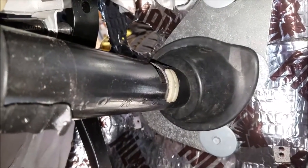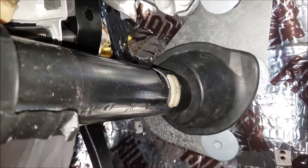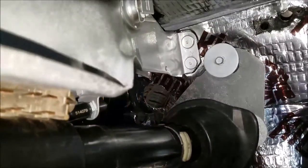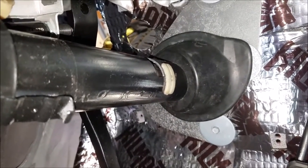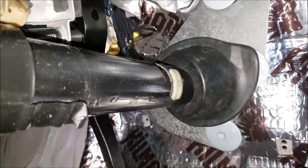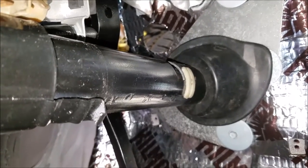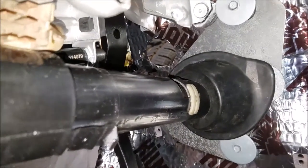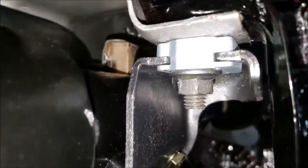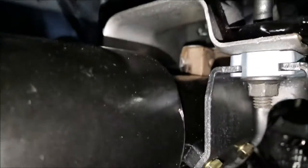So, of course, when I get the firewall pad, it's just a padding there to stop noise. I'm going to have to remove some of this stuff. But this is about moving forward because I want to install the brake system. Now that I got the Camaro together with the subframe in the engine. And the transmission hooked up. So for right now, that is it for this steering column. Also, there's two 15 millimeter bolts. Those are 10 millimeter. These are 15 that hold on either side of the column, the bracket.